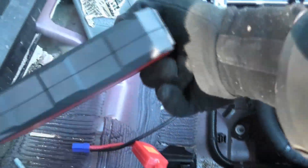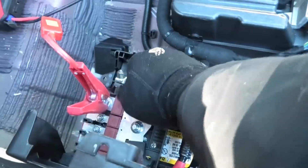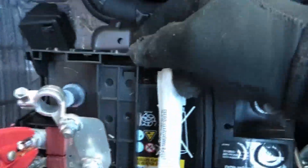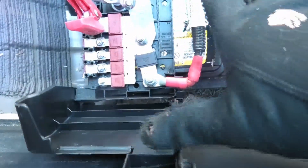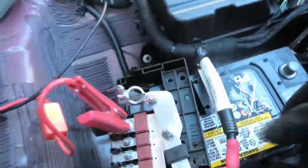Let me plug my battery into the jump pack, and then I'll take my terminals off the battery. Got my negative one off — it doesn't matter if that touches anything now. I've got this positive one loosened, and that'll just slide off. Now I've got to take this plastic block off — there are some tabs down here. If I slide a screwdriver down here that'll unhook one side, and the same on the other side. Push the tab away and that releases the unit. I'm going to set the camera down so I can do this carefully without shorting anything out.